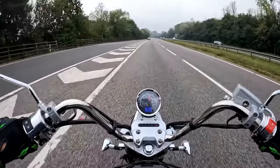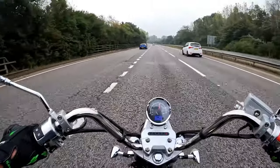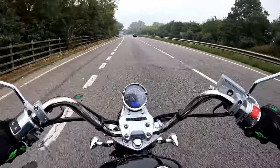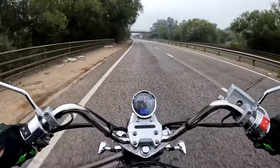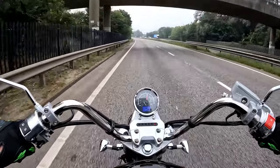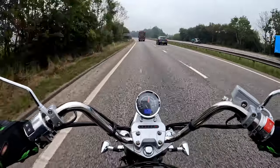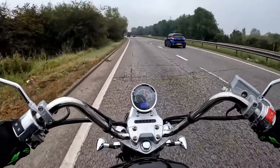Service regularly. I would suggest getting your bike into a dealer. This is a bit quick — for £109.50 is what we charge. Most dealers charge between about £80 and £120, and we charge £109.50, right bang in the middle. What's included on every service we do: oil and filter change, check the coolant if it's a liquid-cooled bike, bolt check all the way through the bike, check the brakes, check the steering, check the lights, check the fuel system, check the tyre pressures, grease, adjust and lubricate the chain if required. Quite a big service, but we do that on absolutely every bike including the 50s and the 125s.